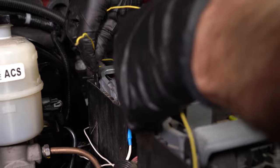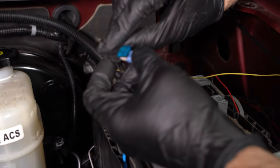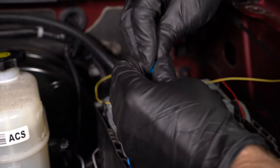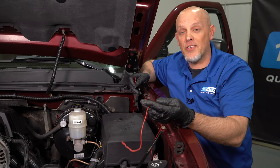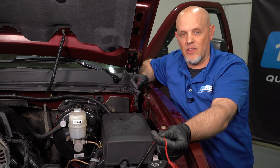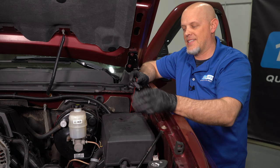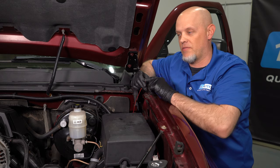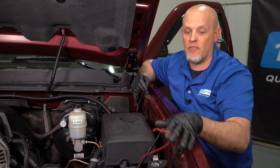Now we can move on to the yellow wires — that one is going to go right here. Get another piggyback connector and we're going to do the same thing we just did with the other one. Now I have the two turn signal wires right here. To prevent from mixing them up: one, you have the length of the wire — I know this is the one that's going to go on the driver's side. Also, before I sent them through the firewall, I did take the insulation off one so that I would know that's for the passenger side. So I have to make an extended wire all the way to the passenger side light, and this one just has enough to get to the driver's side headlight.